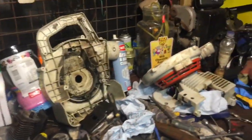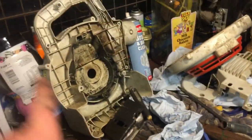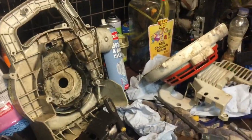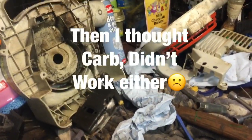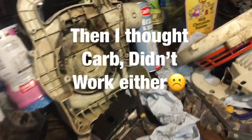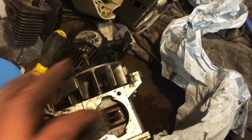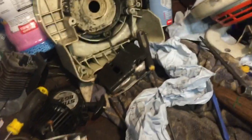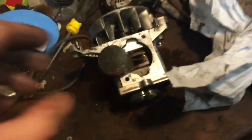I came out here tonight to the shed to do you a video because I thought this blower BG72 spark arrestor was blocked. That was the only fault, but it wasn't until I got it apart that I noticed it was leaking fuel between the head and the block. So now it's escalated to taking it right apart. But actually it's in quite good condition.